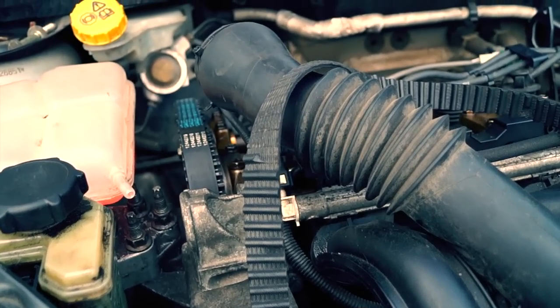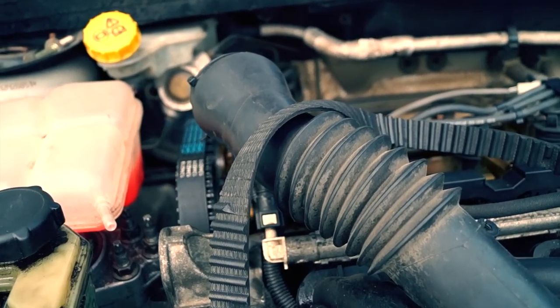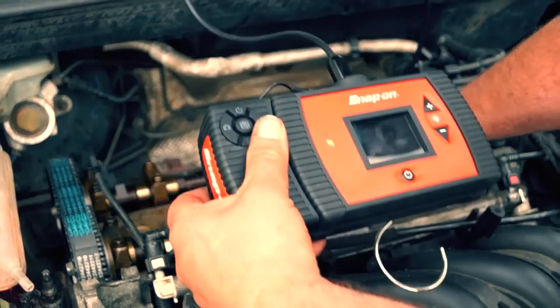Here's the valve now - because it's shut, the valve should be shut, but it's not. Can you see how angled the valve is from this position? Have a look at that - that is a bent valve. So I'm losing compression through this one. This is quite a quick diagnostic and within about five minutes I found the fault, whereas before the timing belt was fitted, it cranked over and didn't work because it was losing compression. So there you go - a handy tool.